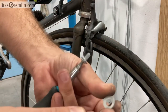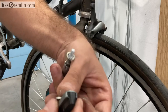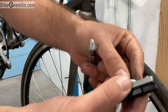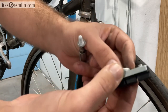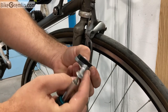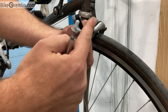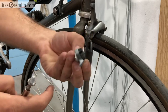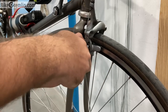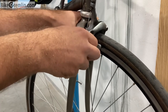I need to put this part onto the brake pad. It has a convex area on the inside which aligns with the pad, and that provides the opportunity to slightly alter the angle of the brake pad relative to the rim for micro adjustments. This fin is used to easily install the wheel later — it's like a small guide to move the tire away from the brake pad and make wheel installation a bit quicker and easier, which is important if you're racing.